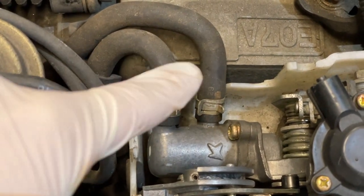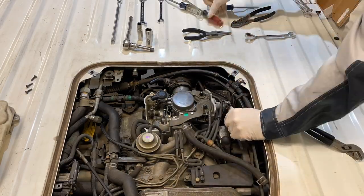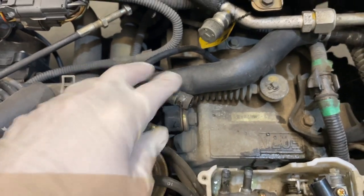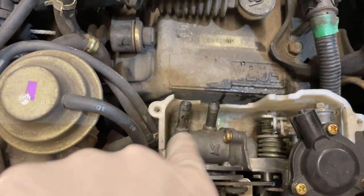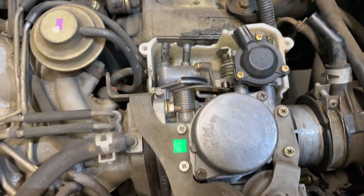And then what appears to be, those are likely coolant lines. All right, folks, as expected, those were coolant lines right there. And what I've tried to do is get them to a high point. That way, we're not going to get any excessive drainage of the coolant system there. This must be some sort of old school fast idle thermo valve. This is found on the B series, D series engines there through the mid 90s.